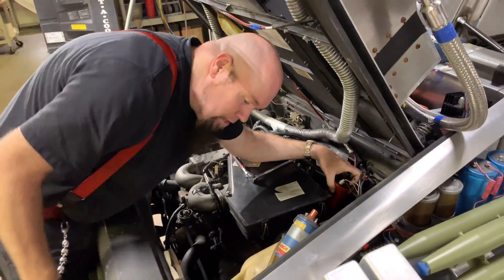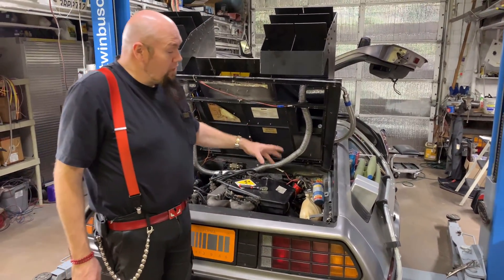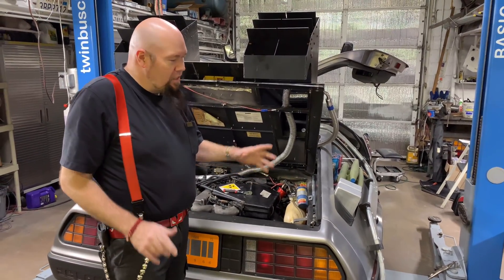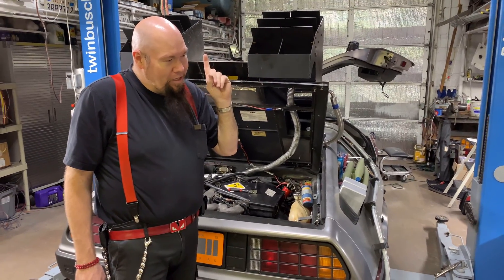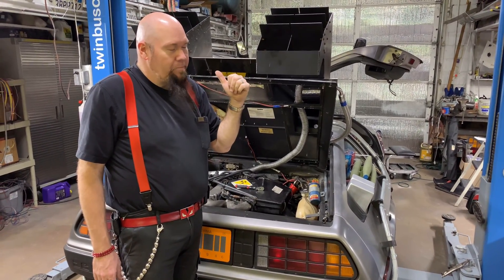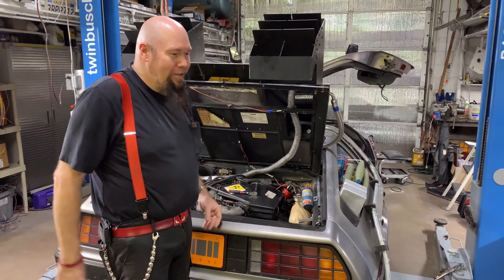I just thought I'd share some content working on this DeLorean. This isn't time machine specific — it's just general car stuff. If you're a DeLorean fan, you probably know about a company called Pertronix that makes an electronic ignition system replacing the coil and distributor. Those are cool, but when it comes to reliability, this old system is better. I've been left on the side of the road with electronic ignition failures — when a sealed plastic electronic ignition goes out, you just have to replace it; you can't fix it roadside.